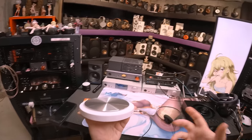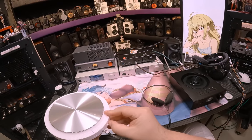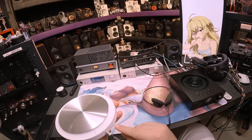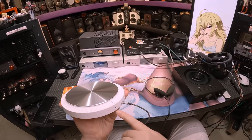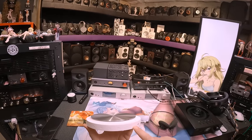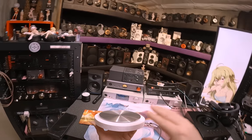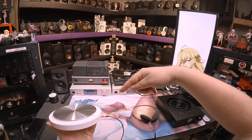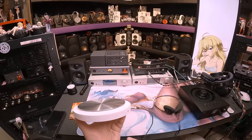Our buttons are the real negative, because you get your on-off and then lock, so you can actually put this in a lock mode so that these don't work. You put it into just on without switching it to off. You got a little power indicator there, a little strip. There's your charge port for USB-C. This is your Bluetooth enabler, which does not disable the headphones. You can run on a headphone and output out there. So if you wanted to put this on top of your subwoofer and then output 3.5 to RCA to your sub and then Bluetooth to a set of speakers, there'd probably be a weird delay issue, but fucking hilarious.